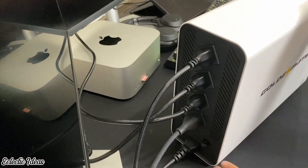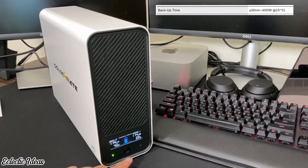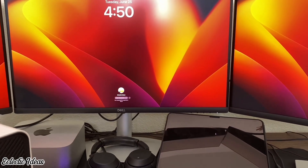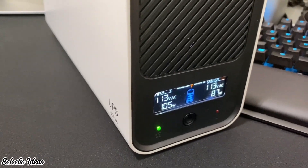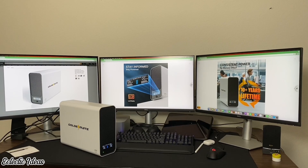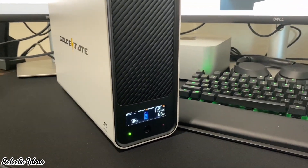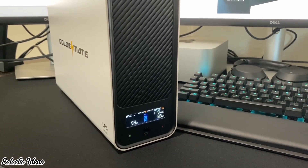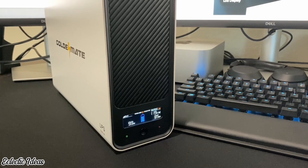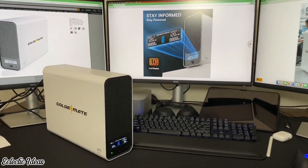It's time to plug in all the monitors with the Mac Studio — we've got the whole gang plugged in. Basically, if you use 400 watts of power, you'll have about 30 minutes or less to shut down. Let's turn on all three monitors and find out how much power they use — it's around 87 watts. So doing regular workstation functions, it'll be under 100 watts. With all four devices using that little power, that will last us about two hours, give or take, depending on what else you're charging and how you use it. That's a nice window to gracefully shut down or just finish working while riding out the power outage.